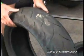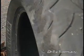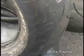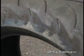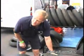And we can see it's got some chronic conditions on it. We got a tear problem, and we have a massive rebound problem here. Probably the most pronounced of the day. Now these tires were from school. So this rider was probably way overweight for the bike. Because of that, put way too much stress on the spring. Because of that, and the inadequacy of the rebound adjustment, gave this tire wear pattern.